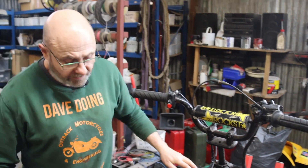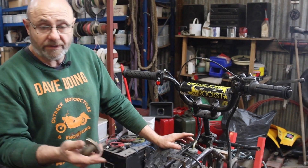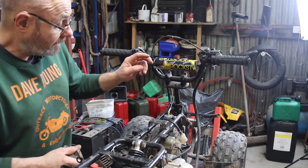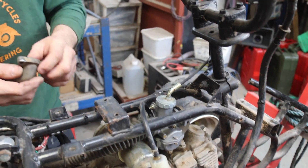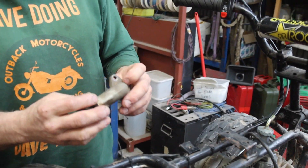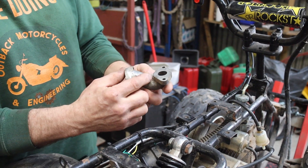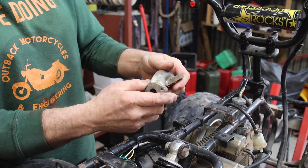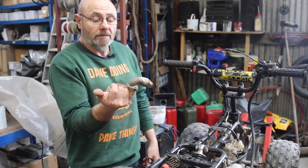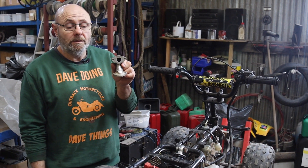This just won't work - it's just junk. That's all done. Electrics are done, got the new switch in. Don't need the ignition key - one less thing to lose. When the battery's on you just press the button and it fires up. Somebody's put a new carburettor on this. These things snap manifolds - the original carbs hit the frame when they bounce and they snap the manifold. I've got one here that we welded up. It's all very well putting a bigger carb on it, but if that hole is the same size as you started with it won't make a solid worth of difference, because it can only suck so much air-fuel mix through that hole.